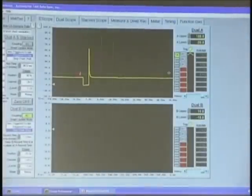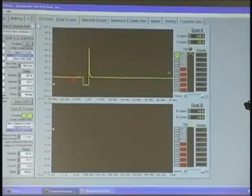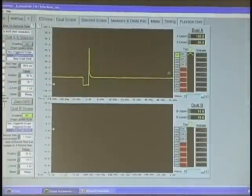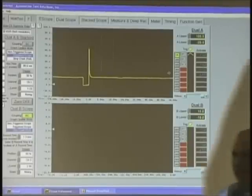Do you really know what's going on here? Look what's going on. This is system voltage, about 14 volts or so. It's being pulled down to ground. It's peaking up over 65 or 68 volts, okay? It's doing it so fast that your meter can't tell you the voltage is going on and off, but it is. So can you use your meter to really check that fuel injector? The answer is no.